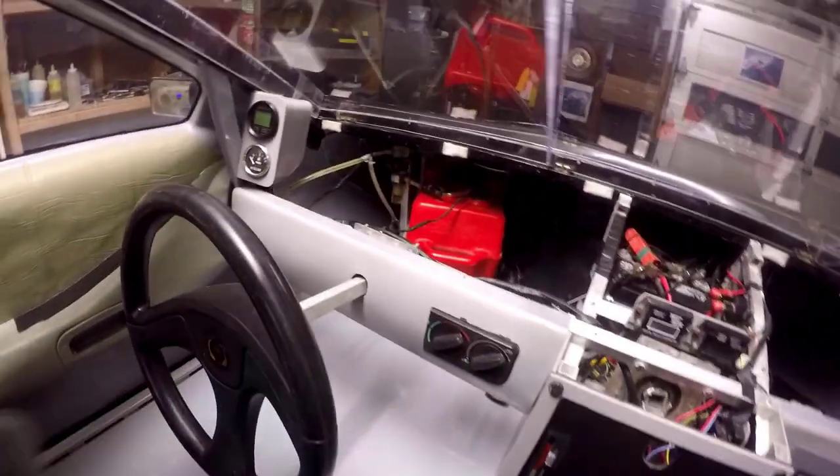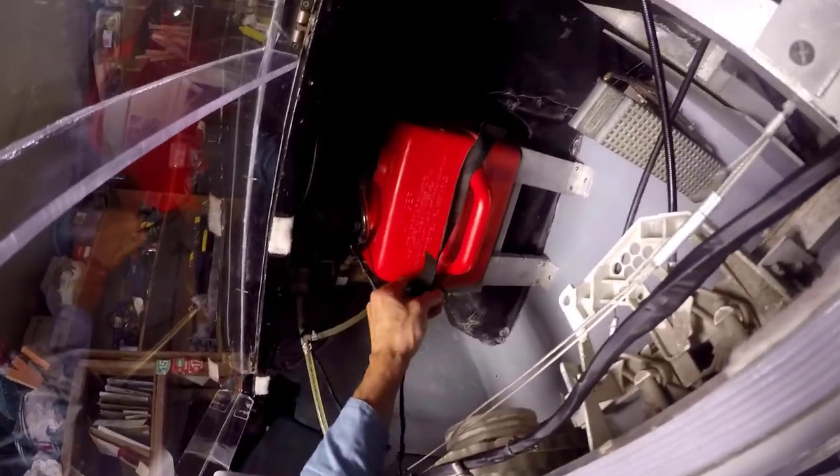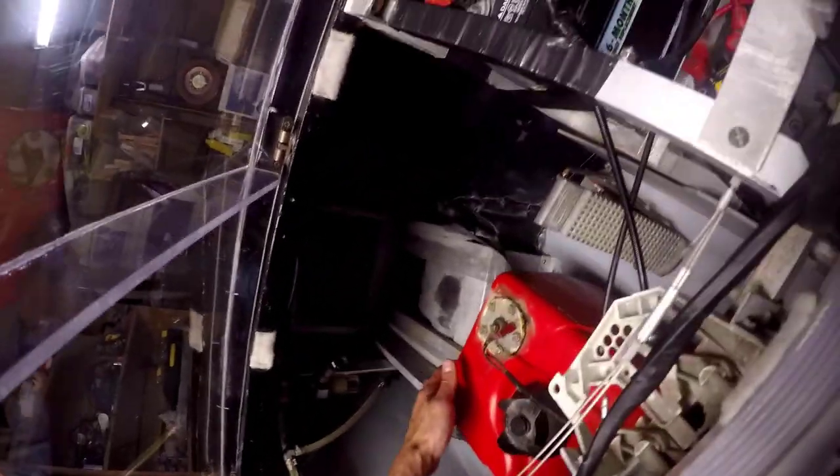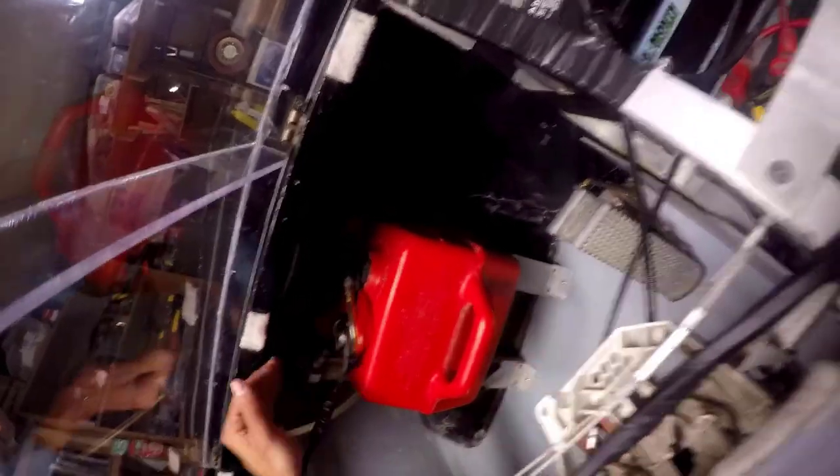Engine cover I made velcros on here. Fuel system — we got a three gallon tank in here, and the way you fill up the tank when you need to is this cinches down and holds it in place, you just loosen that up and pop this quick disconnect off — it's easier with two hands — and then this slides out and you can refill it. That's a water separator filter, just installed. You're going to want to use gasoline with no ethanol if possible, because water can dissolve in the ethanol and create problems.